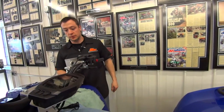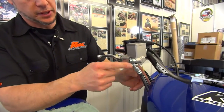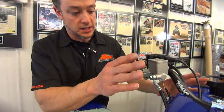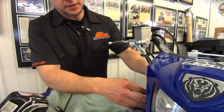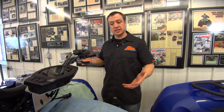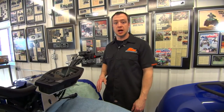The other thing I want to go over real quick before I sign off is the brake lines on these. They ran kind of along the bars and all we did was loosen this up just a little bit and moved it to where it got out of the way. No fluid leaked or anything like that. You got to be very careful if you decide to do that — it'll be fine in the stock position if you decide. We did move this side as well and did the same thing. Other than that, all you got to do is probably zip tie up your wires and lines to give it that nice factory look and you'll be good to go. That's the install of the Handlebar Riser Kit on our 2016 Grizzly. If you have any questions, feel free to give us a call at 218-326-1794 or visit our website at rocksspeedfx.com. Until then, ride safe.